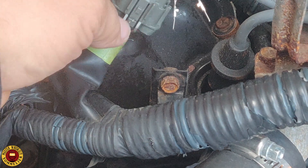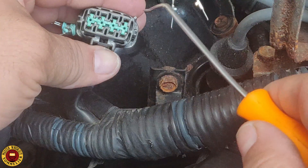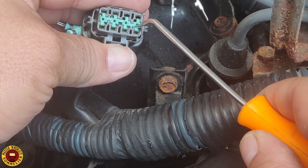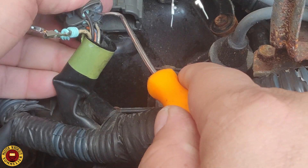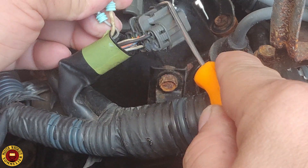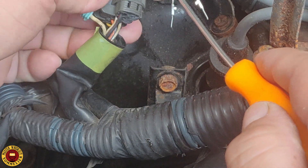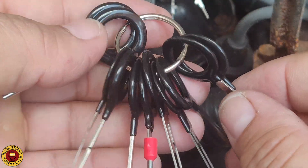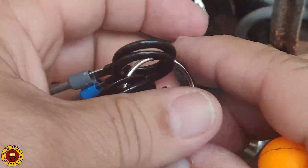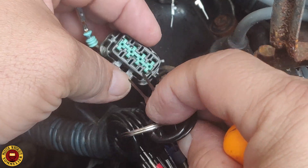The first thing you're gonna need is a pick — a cheap pick from Harbor Freight. You want to remove this green plastic here. On the supercharged model this whole plug is green, but you basically want to remove these two bottom cables. You can see one is white or cream and the other one is gray. The gray one is thicker — that's the main one. You're gonna need a flat tip screwdriver, a really skinny one, or these tools here.